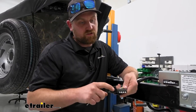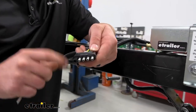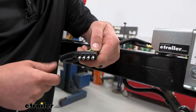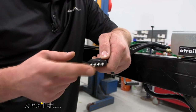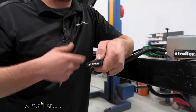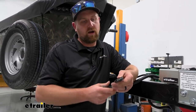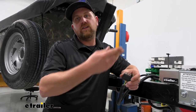Something I want to mention — just since it's a five-way, you can still use a four-way flat. If your vehicle only has a four-way, or if you get in a pinch and need to borrow someone's car, you can still plug a four-way into this — you just won't utilize that particular circuit. On a trailer like ours that's probably not a good idea, but if it's a utility trailer and you're just using it for reverse lights, it's not critical. Just wanted to mention that so you know what you need on your vehicle side.